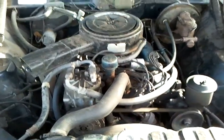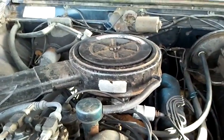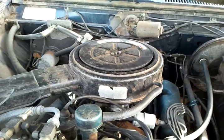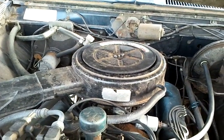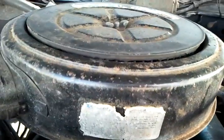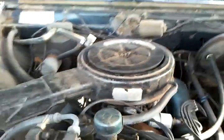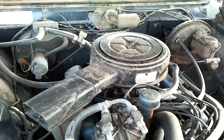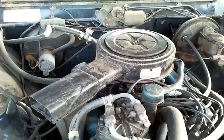I haven't had a chance to start on the engine yet either. One of the first things I'm going to do is replace the air cleaner with a pancake lid, mainly because I can't find an element that will fit. You can just see that element doesn't quite sit level, even though that is supposed to be the correct one. So that may not be the original air cleaner for this car, or maybe the specs have changed.